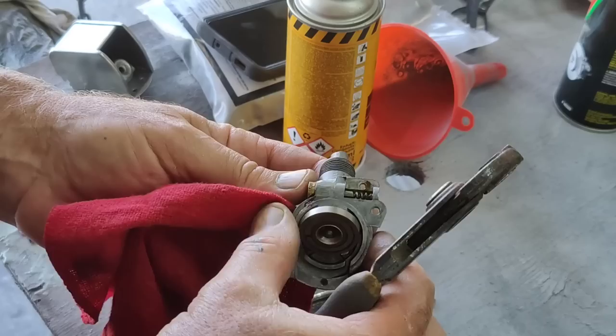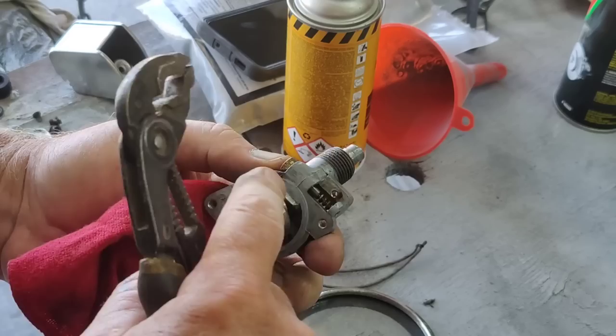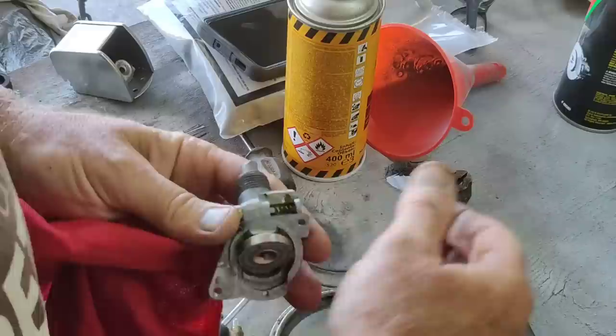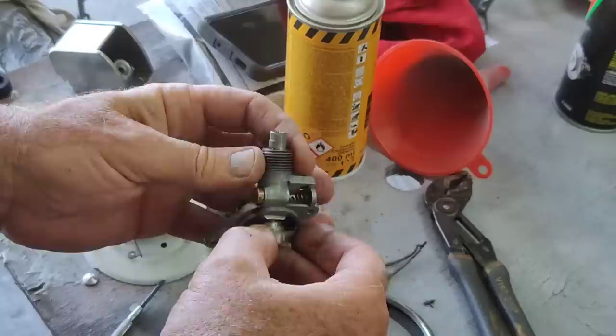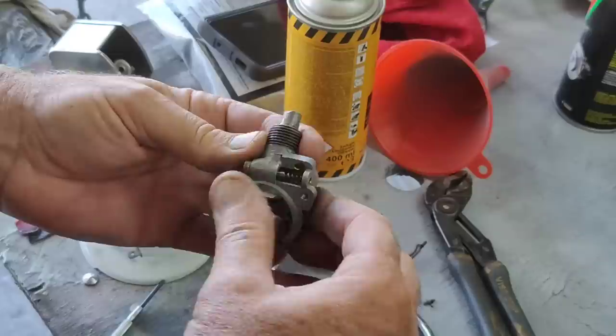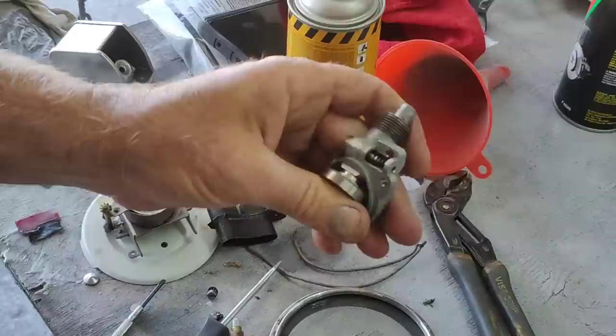Because there's a little set of gear teeth on this thing, and these are both worm gears, and it seems like this one's working because I can see it spin. And now look at how easy it spins. But I still think it'll seize up from lack of lubrication if I don't get something in there. And I don't think I can get anything adequately in there by just... I could shove grease in here, I guess. If I can't get it off, I'll shove grease in there. And I have some 3-in-1 oil, which works pretty good, and I'll put some of that on the shaft. Maybe it'll find the thickener and stay there for a while. Anyway, let me play around with it a little more and I'll bring you back in.